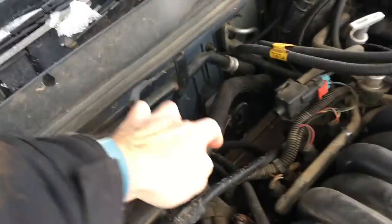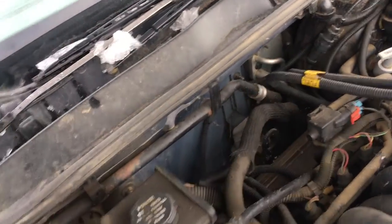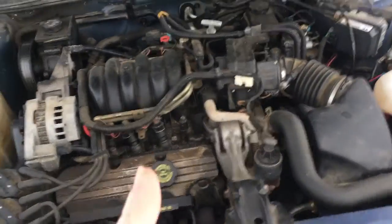And the heater core connections are here, and this guy, as they go down to the heater core down there. So we could flush that. That sounds not fun. So let's do the alternate, which is try the thermostat.